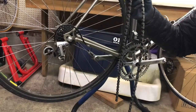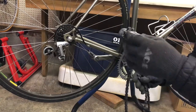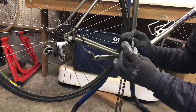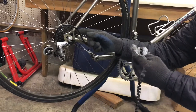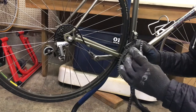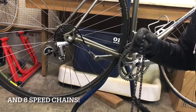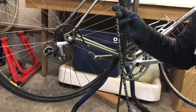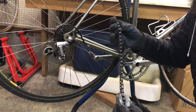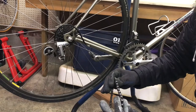I have a used chain on hand — this is a chain I pulled off a bike with similar Shimano components. I think it's the same speeds, though I don't exactly know what speed this chain is intended for. This is a six-speed cassette in the back. This chain isn't worn too bad, and I think five, six, and seven speed chains are interchangeable in the sense that the width of the links and the spacing between the cogs on five, six, and seven speed cassettes is the same.